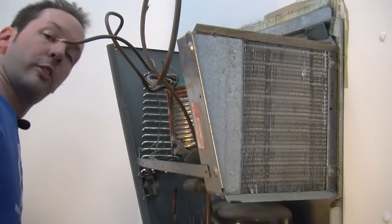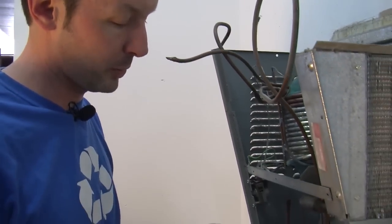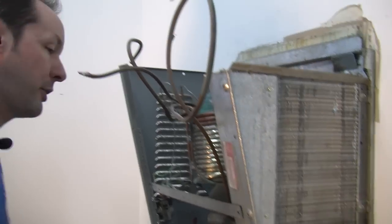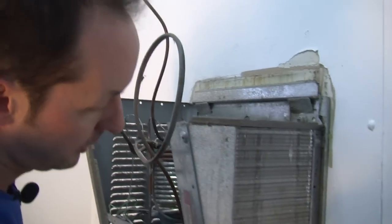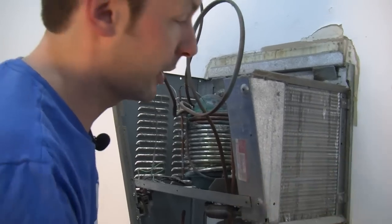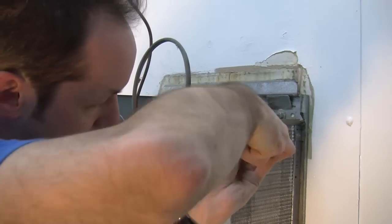Future engineers and manufacturers, you will notice that this whole machine has been made with only two different size screws, okay? 5/16 and 1/4 inch. Now, if you're doing that, why do you need two different sizes of screws? Because really, for this application, they're pretty much interchangeable. You could have gone safe and just used a bigger size for the whole thing. Then you'd only have had to buy half the tools, half the supply chain, save half the time.